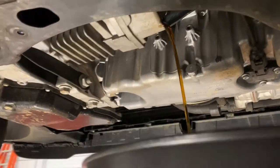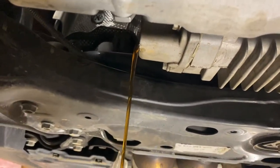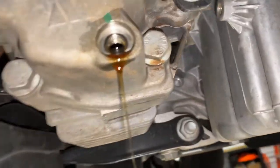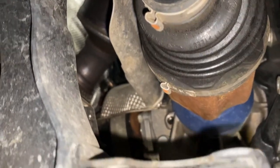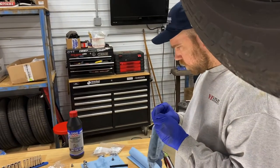Draining some more lifetime fluid out of the bevel box. This will also be getting 75-90. Nice golden brown hue to it, a little bit of liquid Moly. While we're draining here, I'll sneak the camera up there and show you the very conveniently placed fill port - just aft of the axle at the nine o'clock position. Once we're done draining, we'll throw the new drain plug in and grab the Swedish-made pump again. Fill it back up - I think it's 850ml. It's fill to spill: when it's full, it'll tell you.